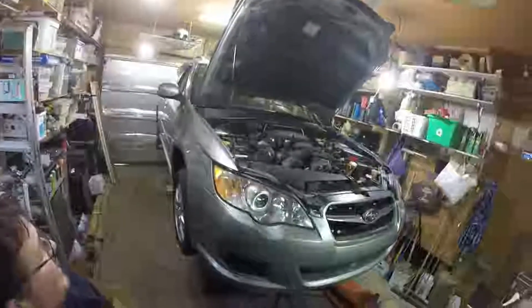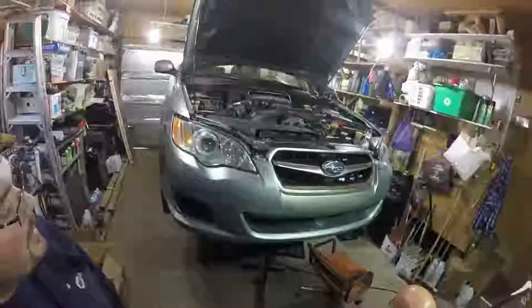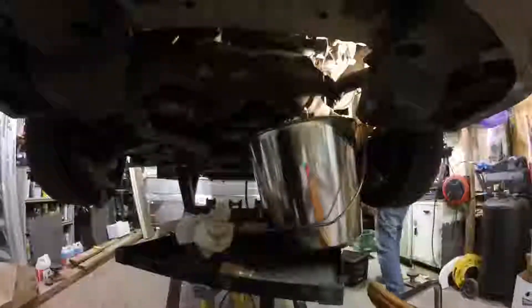This will be my winter car because I'll park the summer car in November. We've already started — first things first is drain the coolant out of the radiator and the engine. I saw on the internet that it was easier to simply pull the hose off of the thermostat housing rather than using the drain plug, because the drain plug can be problematic to put back on. We pulled this hose off and it's draining into the bucket — I'm not reusing this coolant, I've got some fresh one.